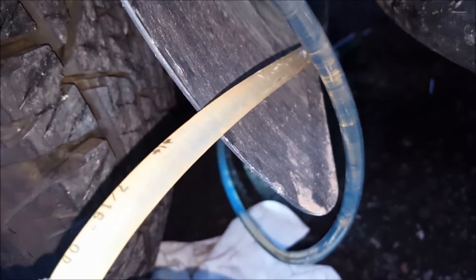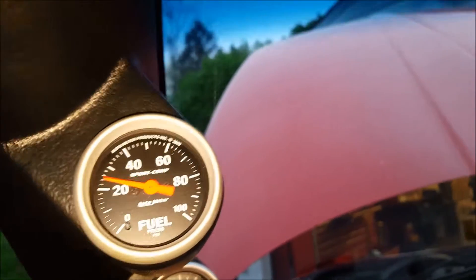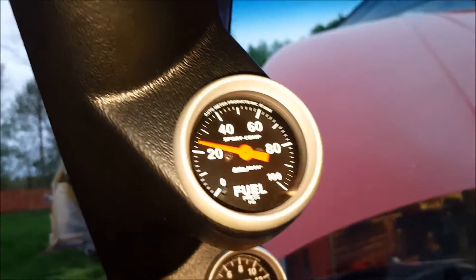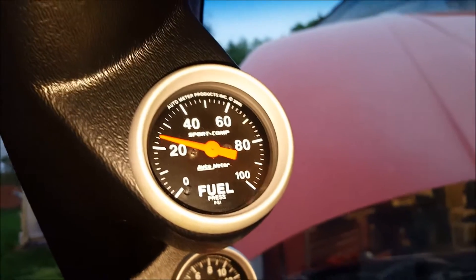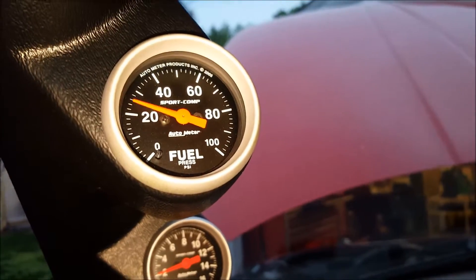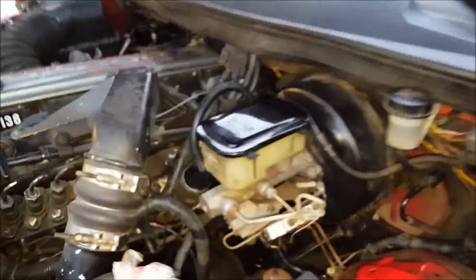After bypassing all this stuff and putting the clamps on, I do have a lot steadier fuel pressure — right at 24 PSI. Might even drop that down a hair, because that's a little on the high side for idle. I have the adjustable regulator, but at this point I'm not sure what the problem is, and it looks like it's ready to downpour, so I'm going to call it a day.